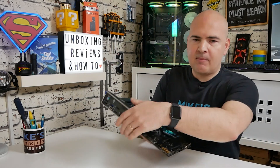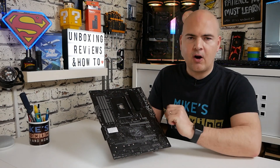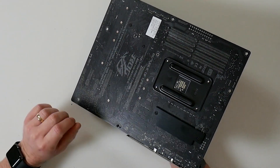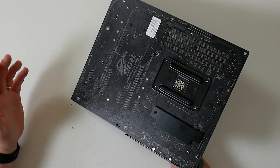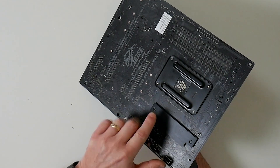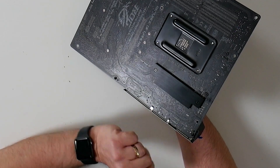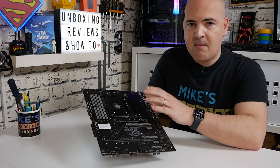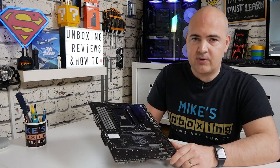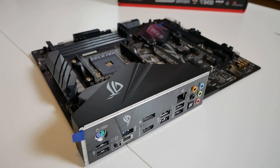Before going to the rear I/O, let's flip the board over. On the back there's a little ROG bling and your standard AM4 backplate. Another inclusion you don't often see on tier 2 or tier 3 boards is a heatsink on the back — on the rear of the VRM section, designed to wick heat away from the VRM. This is something we're seeing more on B550 and X570 boards. Anything which can reduce VRM temperatures and increase longevity is a welcome addition.